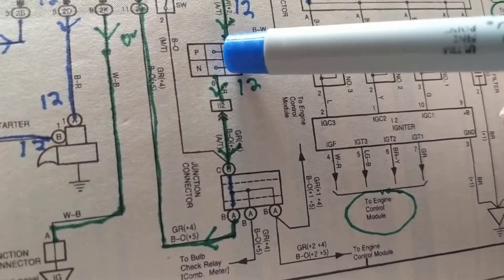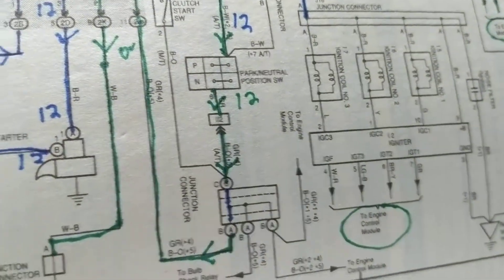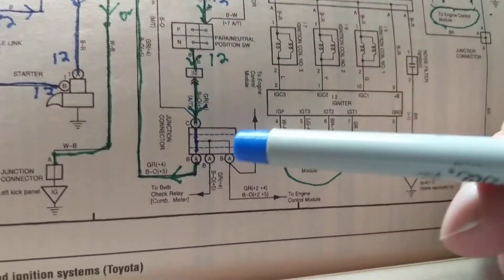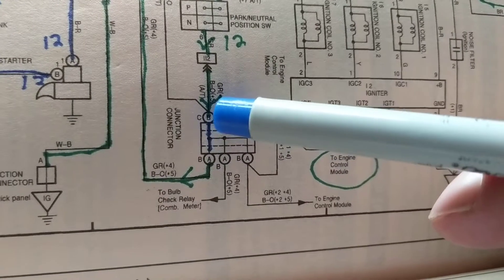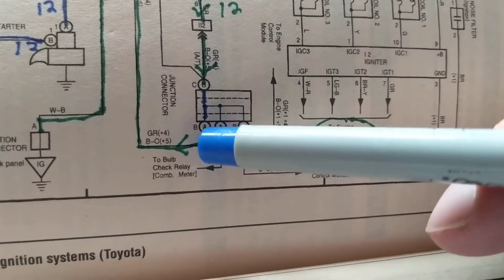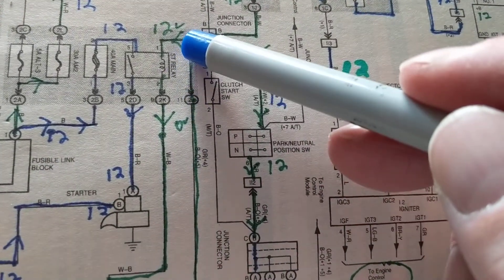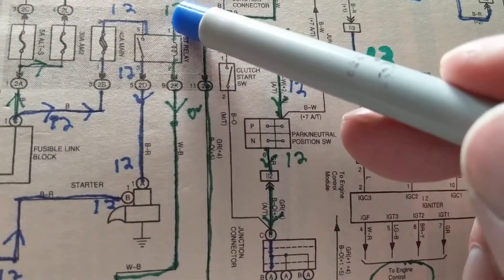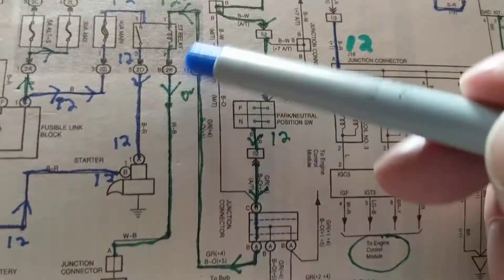We come in here, go over here, and we come out pin six. Either one — if you're in park you go in here, here's the jumper in between them, and we come out here. If you're in neutral, we go in here to this terminal and come out this terminal. We come out this terminal, and the same one over here — either park or neutral. If you can't start the car in park, put it in neutral and try that. We come out here again — Toyota loves these junction connectors. We come over here, terminal C and terminals A and B, and we finally get to our destination: the coil, pin one.